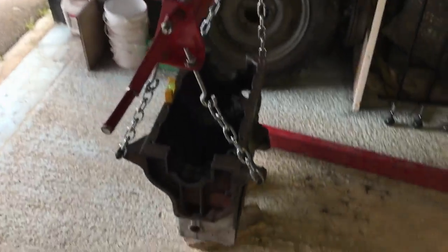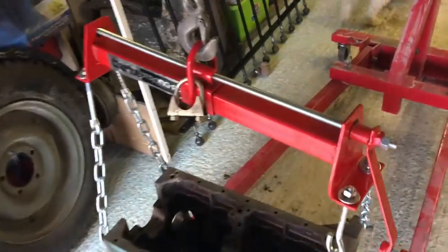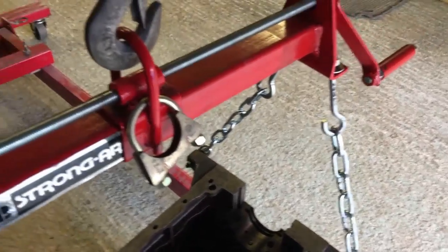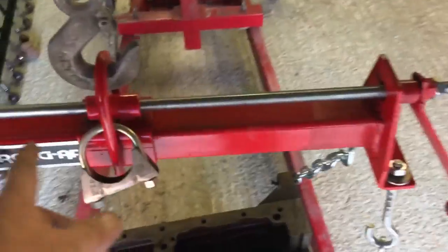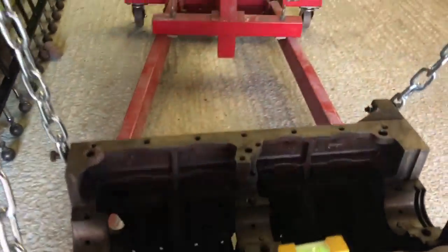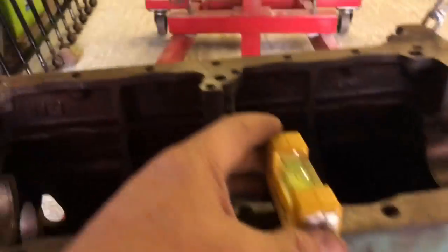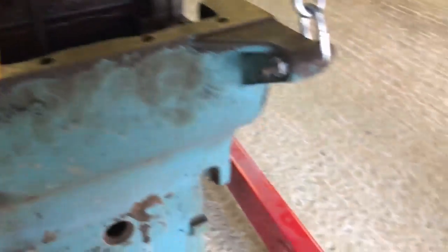Okay, so we've got the engine on the stand now. I'm using this thing - it's a machine made by Clark Strong, basically a lifting sling with a handle so you can move the pivot left and right to get your angle of the engine block correct. I've got a spirit level on there and also using the nuts on these arms you can get the level that way as well. So you can see it's all level and true - I want it to sit in there so the water is up to the same level everywhere.